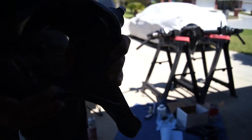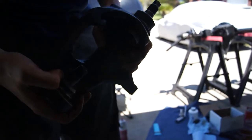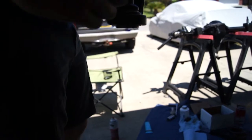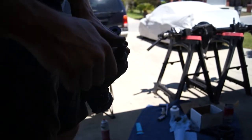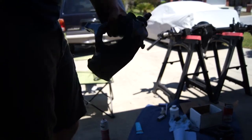My ball joints are already pressed in. The sleeve that goes into the top of the axle itself was taken out and I put a new one in. It'll go 70 foot-pounds down here, the sleeve is 40 foot-pounds, and then the top one is 100 foot-pounds of torque. I'm going to get this in here, do the other side, and go from there.